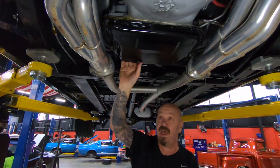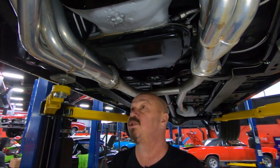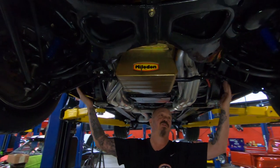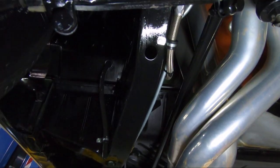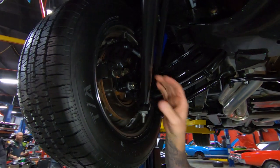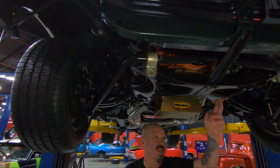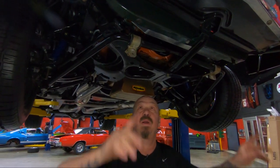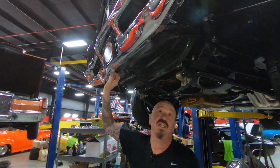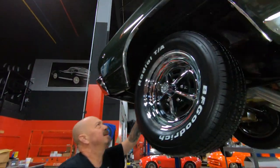We got jet coated headers here — they look like they got just a tiny bit of age to them, still looking sweet. All the steering gears all painted up looking good. The floorboards up here look good. These Mopars — you want to look at the frame right up in this area too, make sure it's in good working order. Nice and clean. All the steering components up here are all nice and clean. Big sway bar here, new bushings. Looks like new shocks. We got disc brakes up front and again, the guys will check out those disc brakes. We got the K-member here all painted up looking good. Sway bar bushings up here looking good. Core support looks good. Filler panels also all painted up. Bumper is just as clean on the back as it is on the front. Look at the wheelhouse there — look how clean that is.